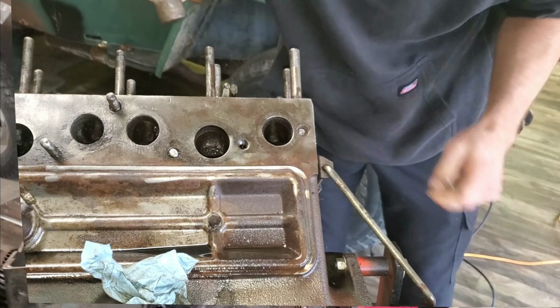Is it biting in pretty hard? It seems like it, I mean, I'm applying. You're still on fingertip strength, so can't be too bad yet. All right, you see what you think. Okay. Oh, before that thing snaps. Oh yeah? See, I was afraid to snap that thing right off. Because you're confident, see? I would slowly but surely turn that thing in there for another half an hour. Another thing is you've got to be careful. It's just that hardened steel doesn't take well to vibration and shock.